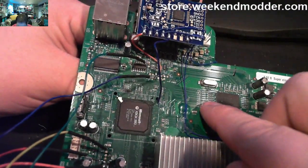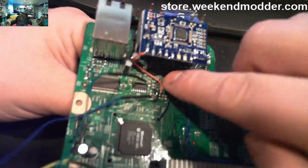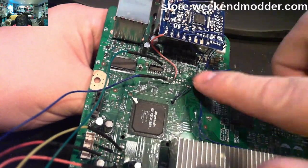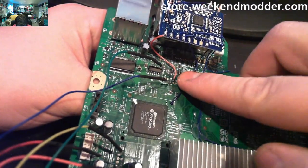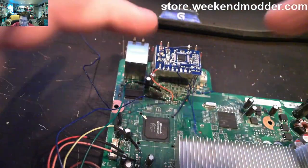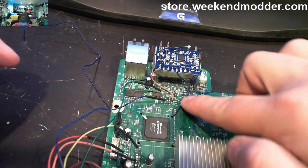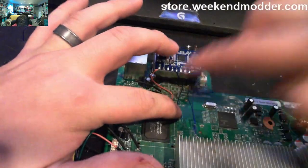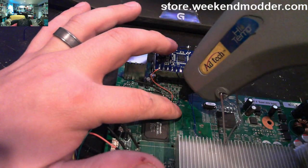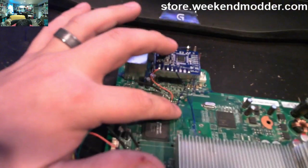near the south bridge. One of the Executor diagrams refers to using the CLK point right over there next to the HANA. But really, that point doesn't offer any advantage and is much more difficult to install, especially for novice users. So what we want to do is make sure that the clock wire there doesn't interfere with the eventual positioning of the DVD drive. If the wire was taut between there and the through hole, you might end up with some problems putting your DVD drive back in.